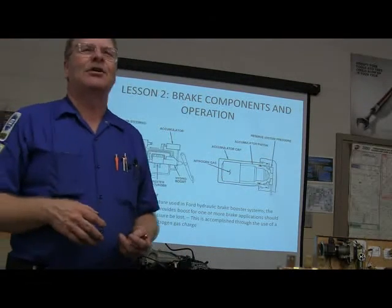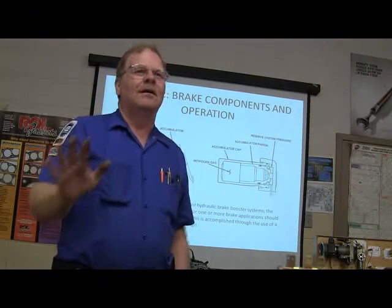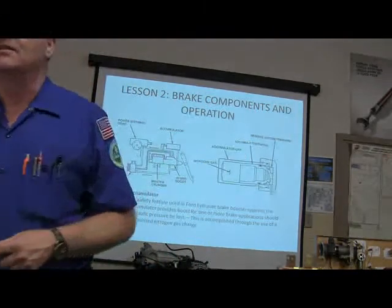So what you basically got to do on one of the ABS systems that's got one of those nitrogen ball things is pump it about 20 or 30 or 40 times with everything shut down to make sure that you release all that pressure.